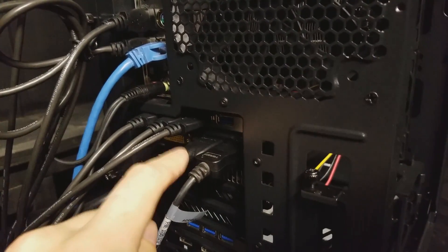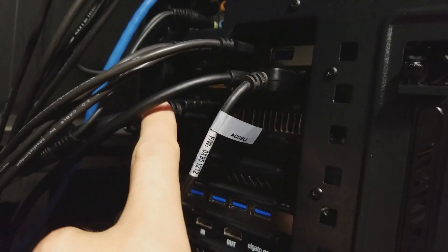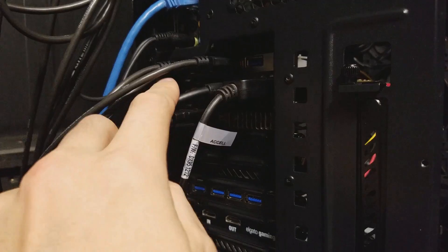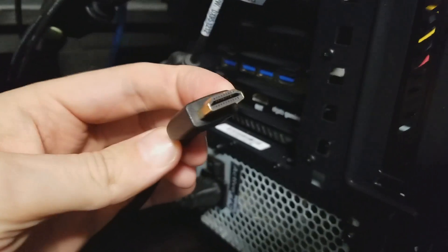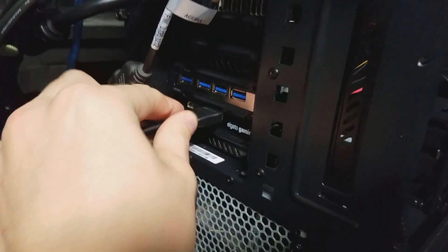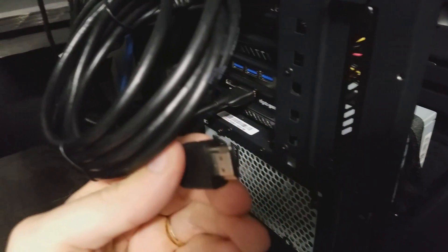Now on the back here, this HDMI cable is for my center screen. This DisplayPort goes to the left screen and this DVI goes to the right screen. But it's the HDMI that I want to be passing through the Elgato Gaming Capture by putting it into the in and then going out to my center screen. HDMI cables only go in one way around, so be aware of that shape — it's kind of angled in at the top on each side. So that's now going out to my monitor, and then I have a looped HDMI cable here that's going to go out of my graphics card and into the capture card.